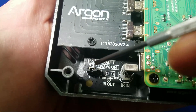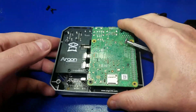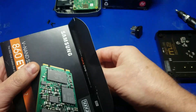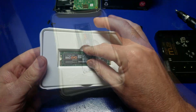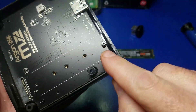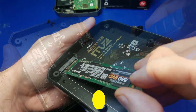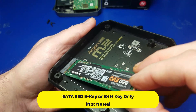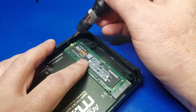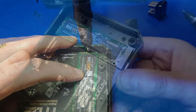Verify that pins one and two are jumpered here. Now we're ready to install the M.2 SSD drive. Here's the 500GB SSD M.2. On the bottom of the case, first remove the small screw with a Phillips head screwdriver. Then slide the M.2 drive into the slot, gently press down, and put the screw back in — that'll hold it down into place just fine.